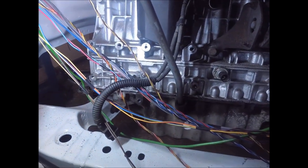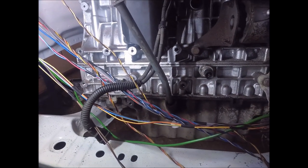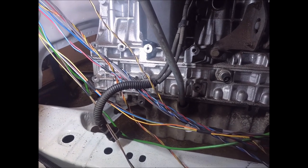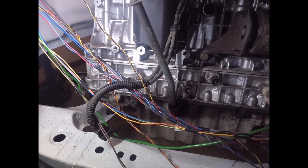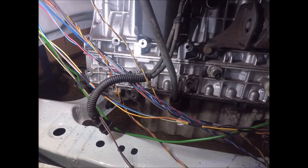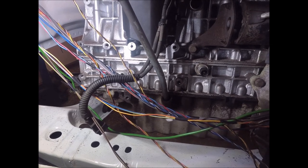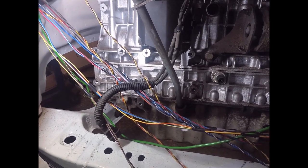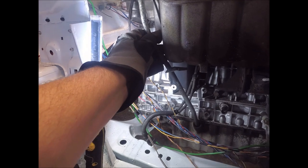You guys know, you can bend a dipstick tube with a regular copper pipe bender. If you just be very careful and do just soft bends, you know what I mean? But that went much easier than I thought. I'm happy with that. Cool.